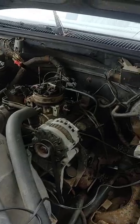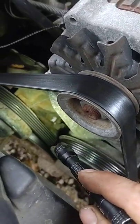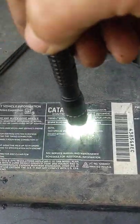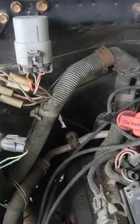The first thing you want to do is mark that big notch in your plate down there — that's your zero degree marker. You'll see on your plate it'll tell you to set it at zero degrees top dead center. Get the engine all the way warmed up. Some of them had a bypass connector right here with a brown and white stripe wire.